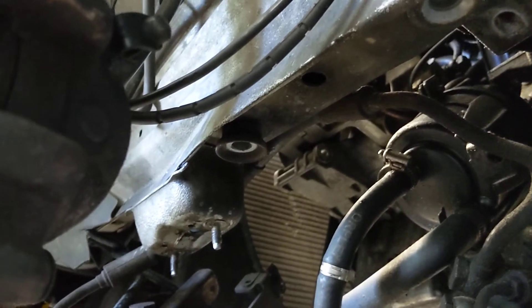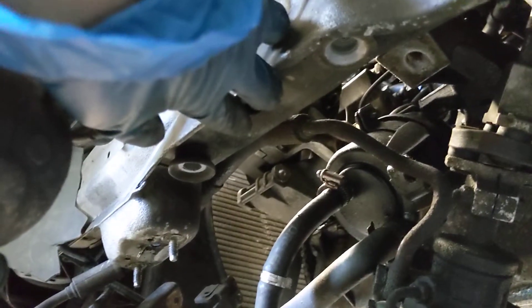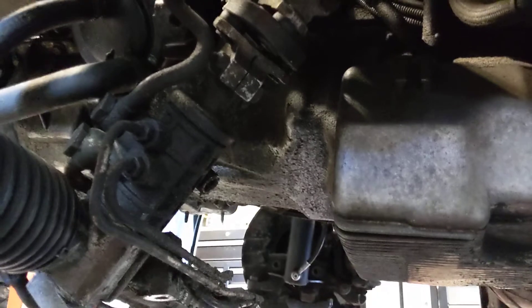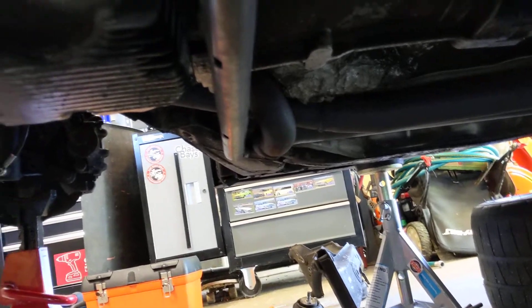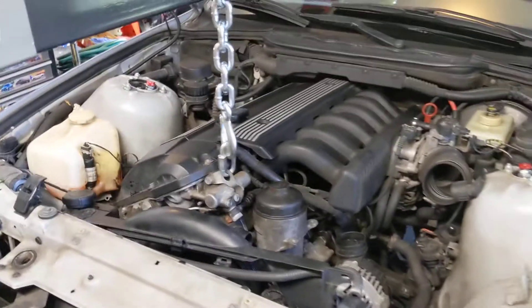When I put it back on, if I slide the steering rack back on the mounts, it's going to land in between the two mounting bolts and you won't have the issue. I'm doing the oil pump and oil pan gasket, and there is plenty of room without dropping the steering rack coupler. I just have the engine supported by an engine hoist, pulled up about an inch so I'm not cranking on it and the exhaust isn't slammed into the underbody. Power steering pump is secured with a bungee strap over the frame rail up front, and I've got jack stands supporting the knuckles, pushing them out of the way.